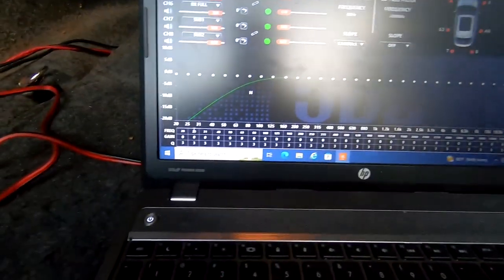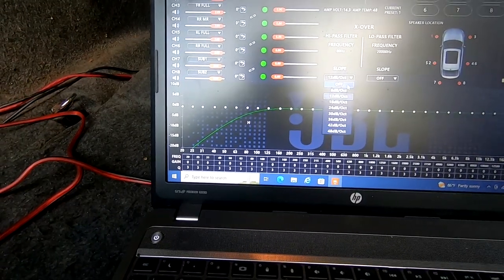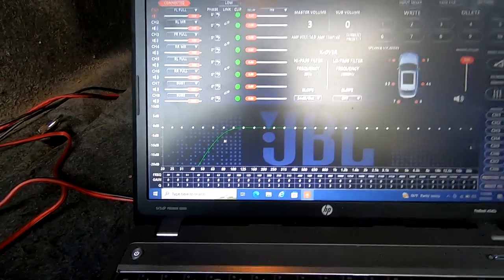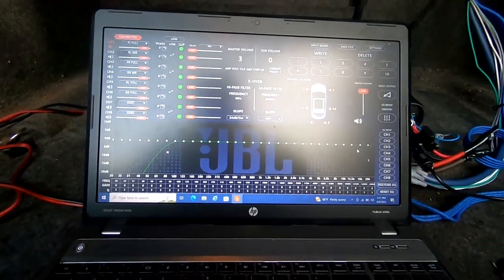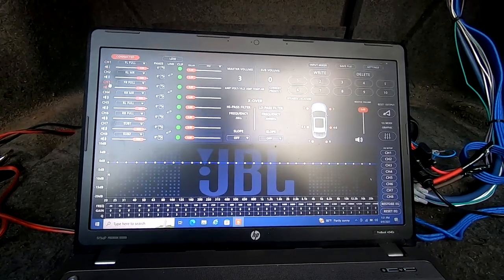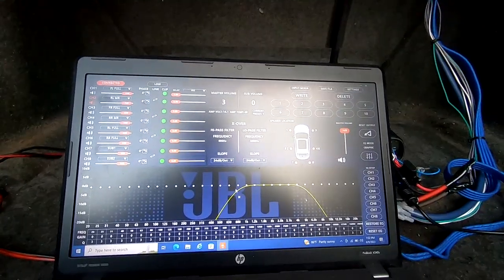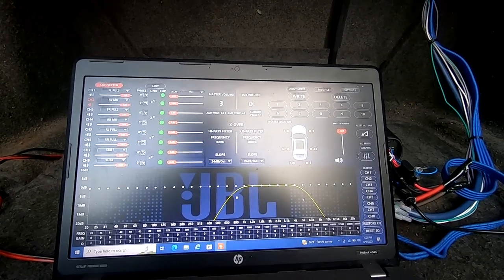So now I'm getting started on my crossover points. Even though my channel 1 output is labeled as a front left full, I am going to limit it to 80 hertz at 24 dB so it doesn't play below 40 hertz. So now I'm moving on from channel 1 to channel 3. Channel 3 is going to mimic channel 1, where it's going to have an 80 hertz crossover high pass filter, and it's going to have a slope of 24 dB.